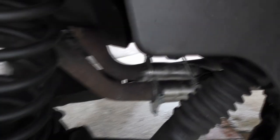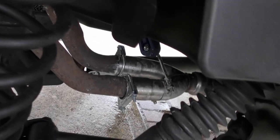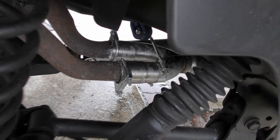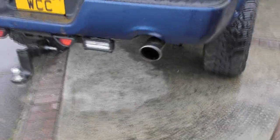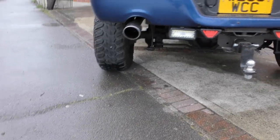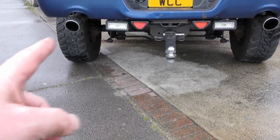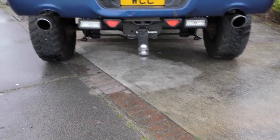Have a quick look — there is a nice new pipe connected on, and there it goes all the way down the back. See in there it connects. I think they went a little bit too far, and I want to tidy that up. The exhaust is a little bit lower, and I think that one's slightly out, so I've just got to get that one there, move it up and in a little bit, and that'll be done.